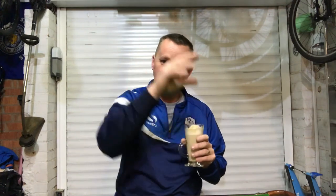Well, that clutch plate, that was a really good example of a completely overheated clutch. I mean, it was unbelievable. It was like a load of mush in there. And you can just see the difference. A worn clutch, worn out normally, is dusty. There's loads of dust, very, very fine, horrible fine dust, like brake dust. But this one, you just knew it had overheated because of how it turned into that... Oh, pardon me, that's my coffee. It turned into that wiry, bird's nesty kind of material and just scattered itself into all the orifices. Oh, that's a good word.